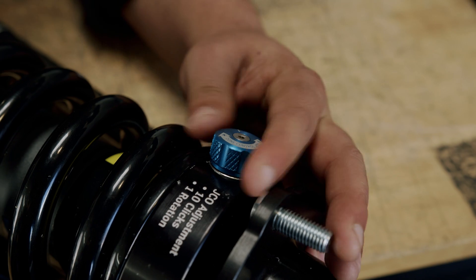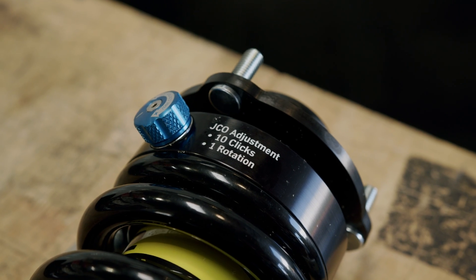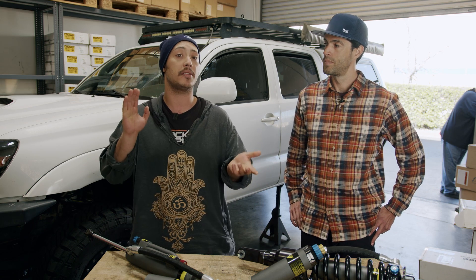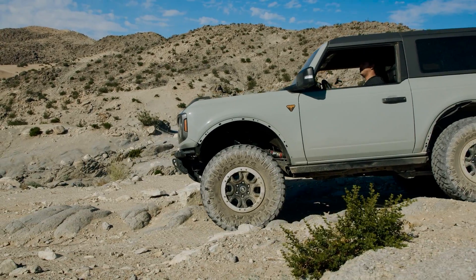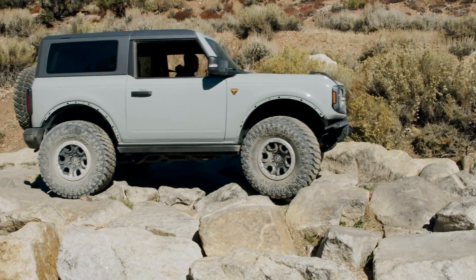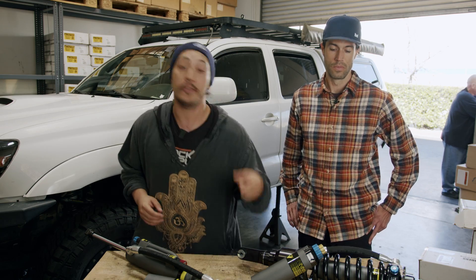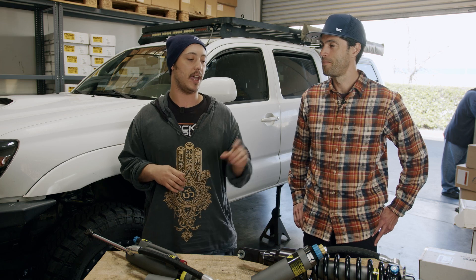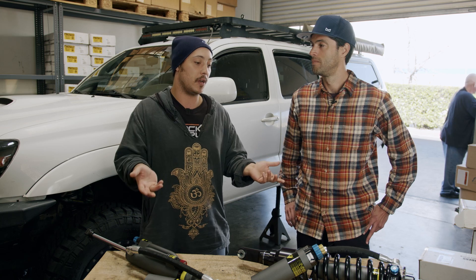Those JCOs are effectively a hydraulic bump stop inside the shock. I've even noticed on my Bronco, which has the factory yellow ESCVs, it would articulate right until I could feel that down-stop engage. If you're taking it slow in a rock garden, you don't have the same drawbacks on bump travel and articulation that you'd have with standard 8112s, because you can back the jounce adjuster off. Also, sometimes with 8112s you hear that clack-clack of the jounce stop engaging — when you back it off, it doesn't make noise, and you really don't need that jounce stop on the street.